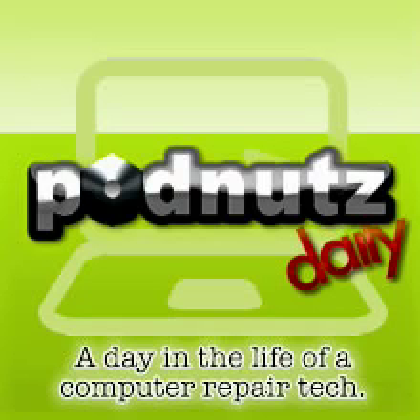Got an HP laptop, a DV6000 — a 14-inch HP laptop — running Windows Vista. Whenever I tried to start Vista, it would crash and reboot. I finally resigned myself to just back up all his data and then go into the system recovery and do a full system recovery from the recovery partition.